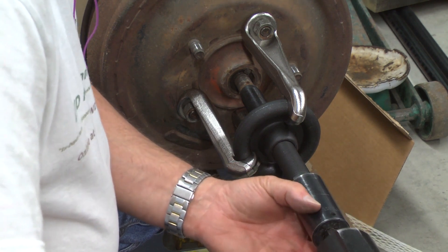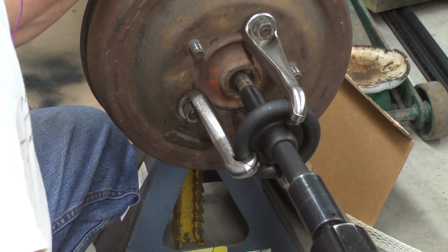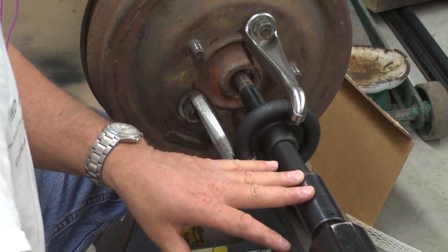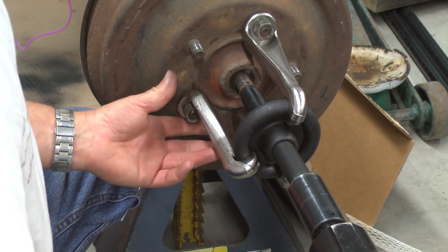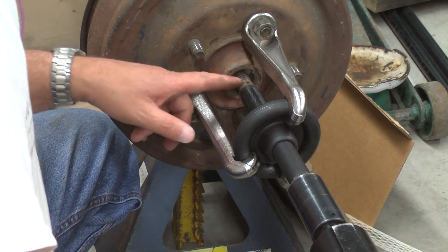For this application I'll start with the lower force. I'm wearing my ear plugs and using impact grade six-point sockets. The nuts are tight, each arm is flush against the drum hub, and the stem is on center with the axle shaft.